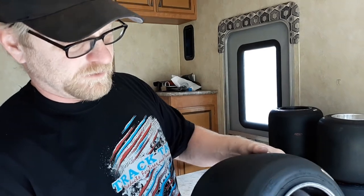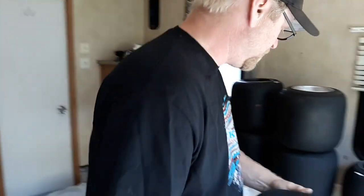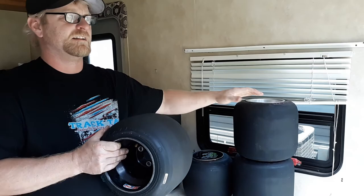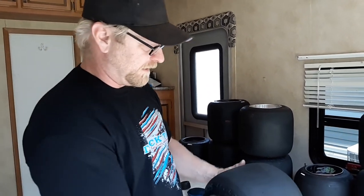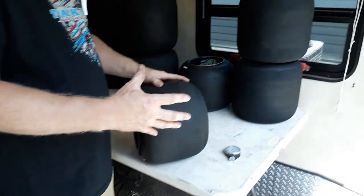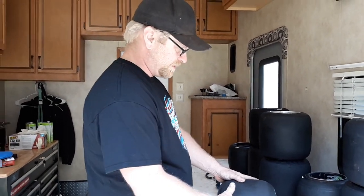These tires here have a lot of air pressure because we have to stretch them. These are set at 25 PSI and I think these were set at 20, just to get them where I want them at the desired track pressure. So if you're going to race at a three or four pound split, you want to let the air out to have it measure three and four. If it's too small you've got to stretch it, if it's too big you've got to shrink it.